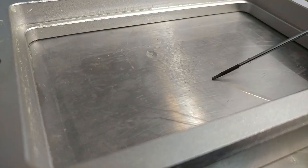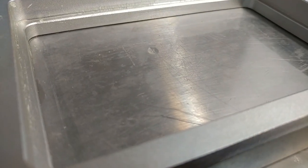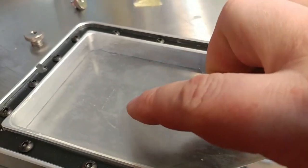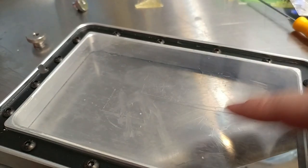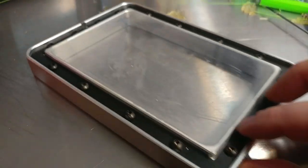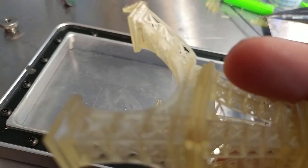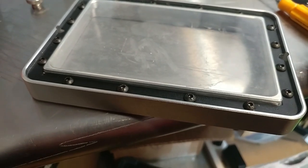I turned the screwdriver sideways accidentally, and I poked holes in this FEP sheet. And so I had to use scotch tape to fix it. So on this side, after thoroughly cleaning it so it would stick, I put pieces of scotch tape. This one was leaking, and these two look like they're about to leak, so I put scotch tape on all three. And that affected the print a little bit. You ended up with little holes. Like here, you ended up with this little broken area there because it was shining through the tape, which affected it, but that was okay.